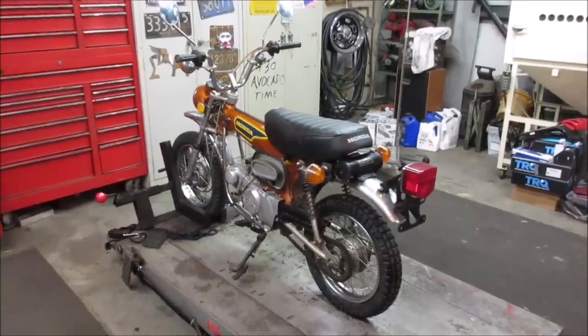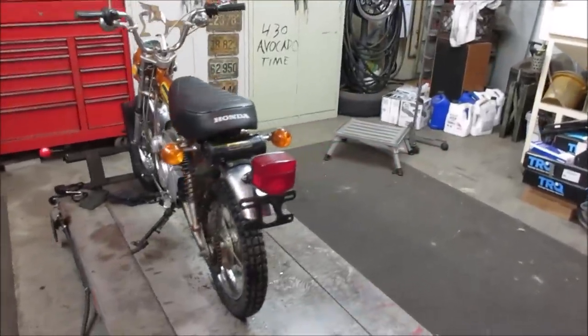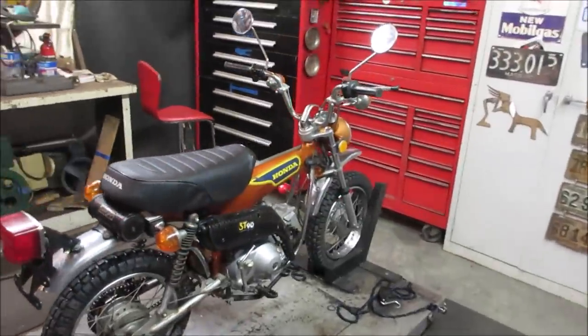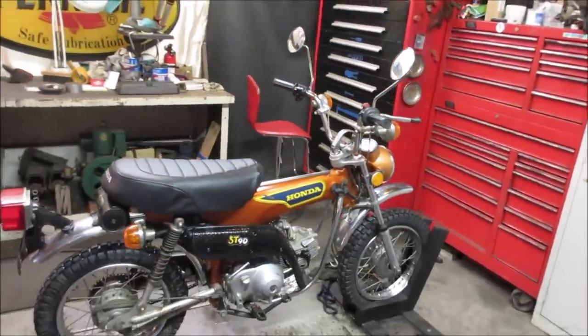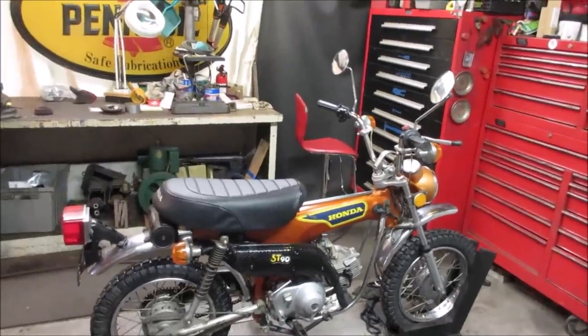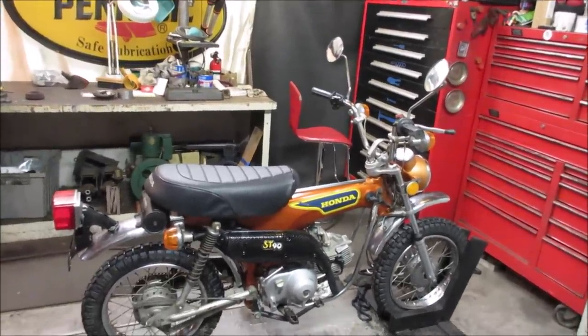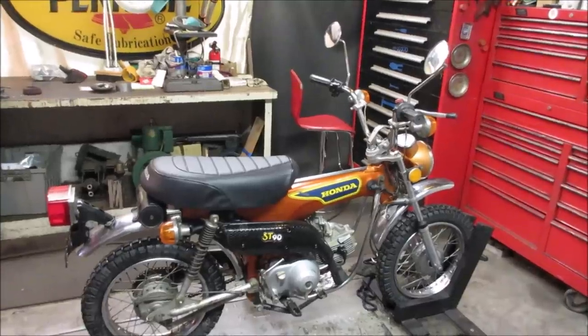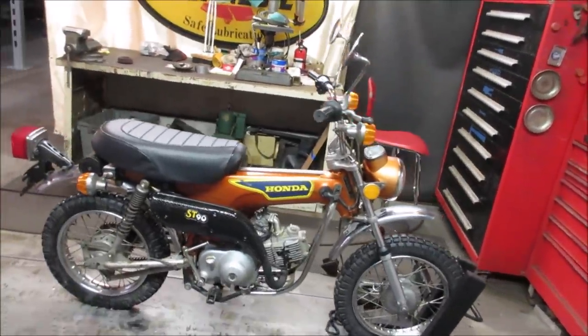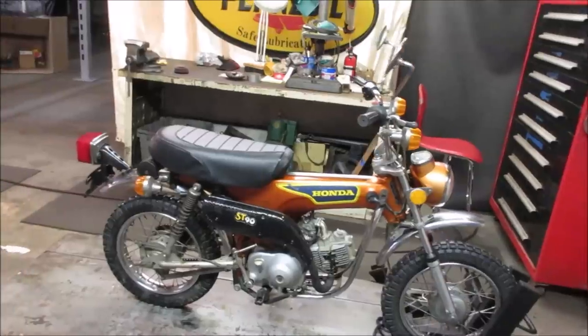Well, I think that worked out pretty good for a shakedown run. I don't see many issues. Anything to deal with is, again, the air cleaner. It's a little lean here when you go to take off, and being 20 degrees doesn't help things neither. But when the air cleaner is on, it'll cause a little bit more drag and richen it up just a hair. And the warmer temperature. And then everything seems to have worked out pretty good.